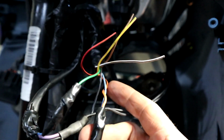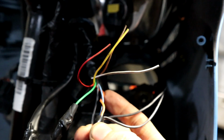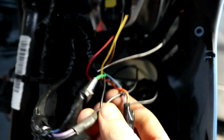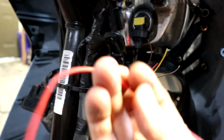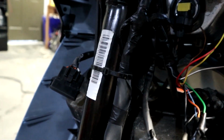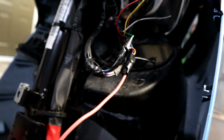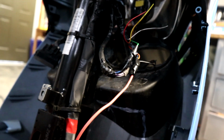And then we have the orange wire here, which is power out, running into one side of the light switch to run up for the city lights, and then runs into the blue on the 8-pin or 7-pin connector there. And that's really it. These other wires are all do nothing. They're for sensors for the 4-stroke that aren't there anymore. And I have this extra red lead that's going to run down to the water pump, and also a gauge up rev counter. So with all that, we are pretty much caught up with what it took electrically to make this work.